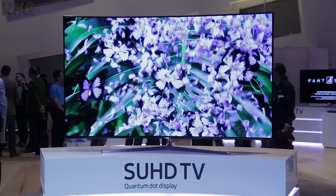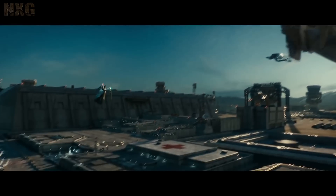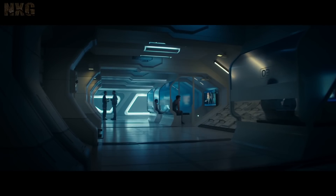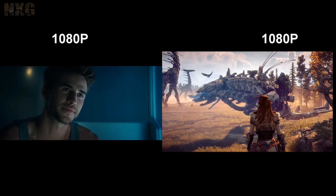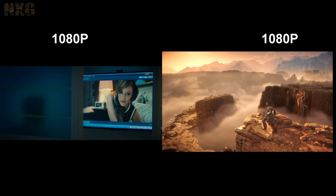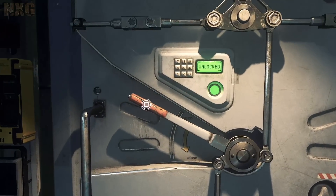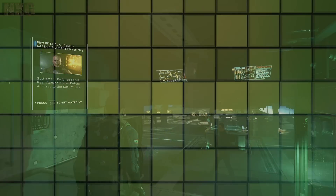The new standard also increases frame rates, allowing 60hz or 60fps for movies and games at this new resolution. The old format can only support 24 or 30fps, and that has now increased along with dual HD display which some TVs currently support with picture in picture. If you want faster than 60hz for PC etc., DisplayPort or DVI is still your only option for now. HDMI 2.0 can theoretically support 1080 at 120hz but no devices at present support that, though that may change.